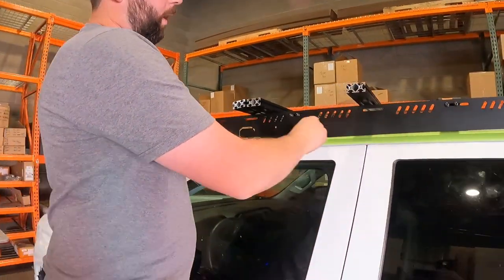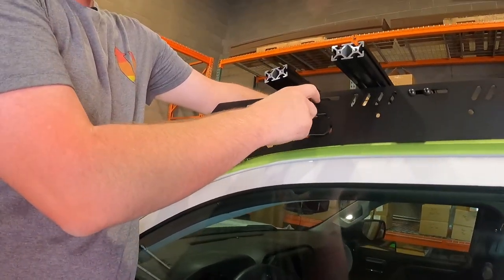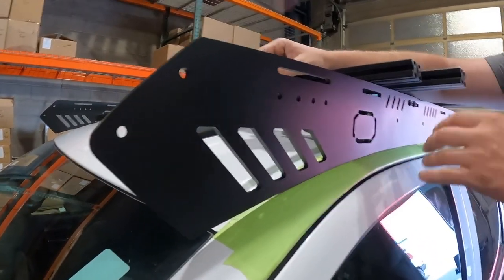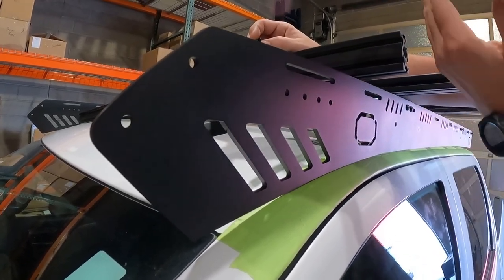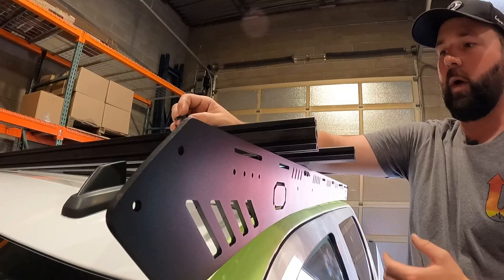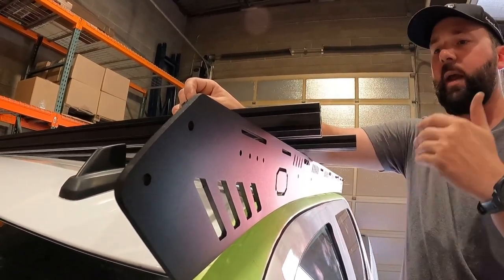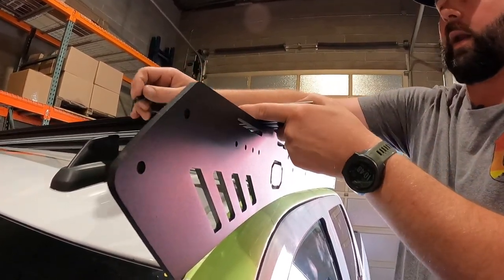Repeat that process for the load bar between your first and second mount feet, and for your second load bar as well. At the very front, you have an upper slot and four holes. You can run the front load bar horizontal — two-inch face upward — or vertical, with the one-inch face up. We run it vertical on the front to handle bigger light bars: whether you run an LP setup or an Onyx 40 dual, those are heavier setups and running the bar vertically provides more stability and rigidity as you're going down the trail. Since we're installing a no-cut on this truck, I'll go ahead and go with horizontal.